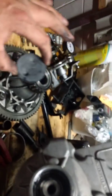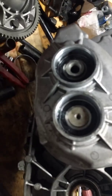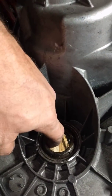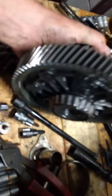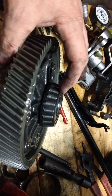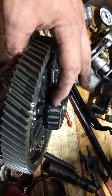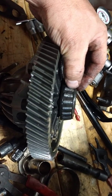Fortunately, the kit does come with new seals — here are the destroyed seals. Be very careful not to ruin the machined surface when you try to do that. Now, what did fail on this transmission is right here: this oil seal failed, but also the differential bearings. This one doesn't look too bad, but flip it over and look at the other one — completely destroyed bearings. Those will have to be repaired.